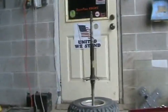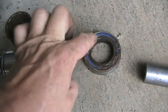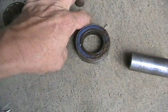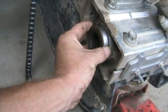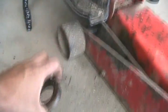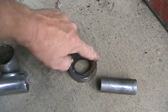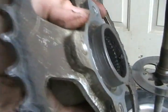Now I've got to roll up a rag, shove it through there lots of times, get all the crap cleaned out, clean off the axle surfaces, regrease everything, and knock some bearings back in. Whenever you reinstall bearings, never hit them on the inner part or you'll dent the little balls and where they roll on their race, and the bearing will fail shortly after. You have to find something big enough to press them in. Very often what works best is the old bearing - get the new bearing started, tap it in with a piece of flat metal, then once it's flush put the old bearing against it and hit it that way, because it'll contact the outside edge and won't damage the inner surface.